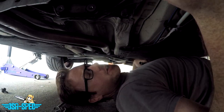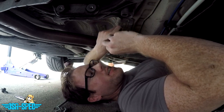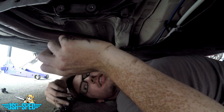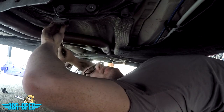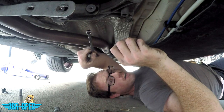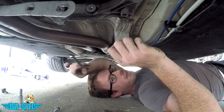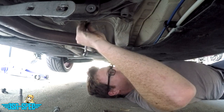Okay, it took about 5 minutes of trial and error to line up the cross brace and the transmission mounts, but I think I got it. So I snugged the fasteners up by hand. So now let's try to get the top fasteners in place. I found a ratcheting 12mm and a ratcheting 14mm, but I couldn't find a ratcheting 13mm, which is the most typical thing to happen in this garage ever.